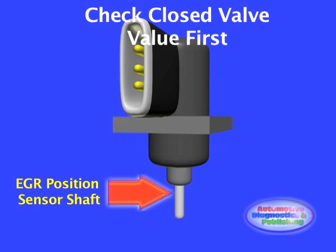Make a preliminary signal voltage check with the EGR closed to determine proper calibration. A raised EGR diaphragm caused by carbon deposits is common. Clean the EGR valve if necessary and then recheck further.